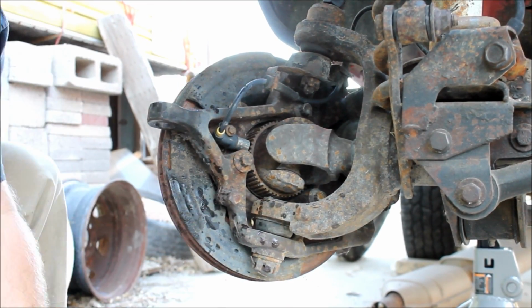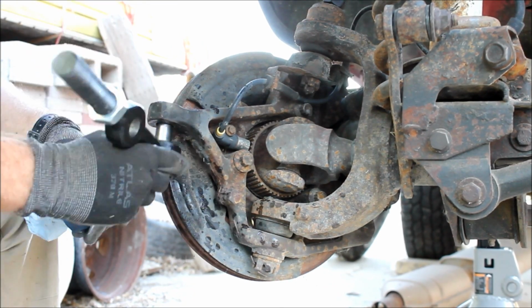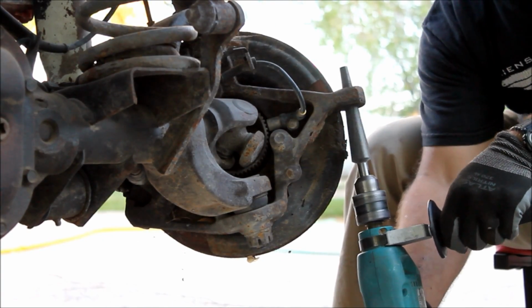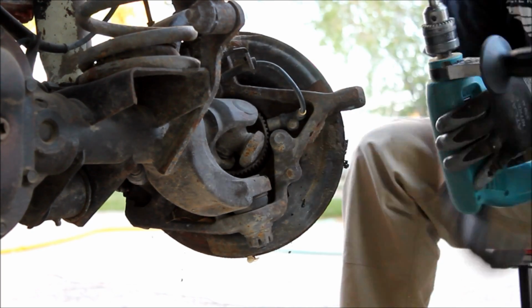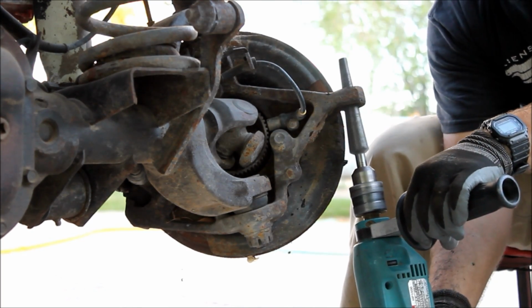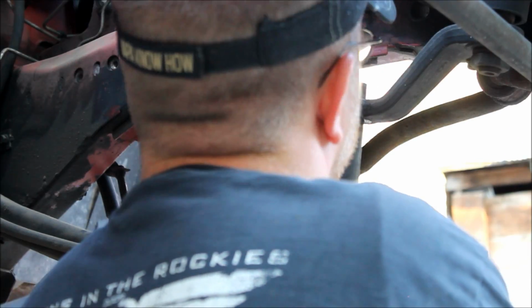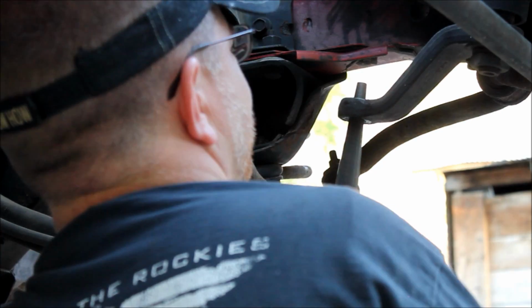But when it came to the Pitman arm, it's much harder steel. And in fact, it ended up ruining my $80 reamer. So I was able to get the hole as big as I needed it to, but I destroyed a very expensive tool. So I think maybe I'm a very expensive tool. Anyways, don't be stupid like I was. Drill these out first with a drill bit.